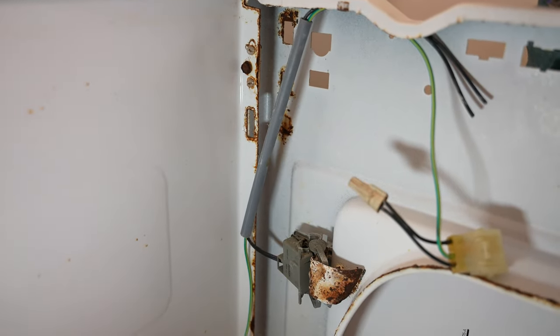Get those white plastic hooks to hook back in — it should be fairly snug. Put the two screws back in and put the trim pieces back on starting from the bottom. We're done! To pat yourself on the back, test it by opening the lid and closing it — you should hear a nice click. That is how to replace a broken lid switch and get your Whirlpool or Kenmore washer to spin again. If I missed anything, let me know in the comments. Don't forget to mash that like button on the way out — I'll see you next time.